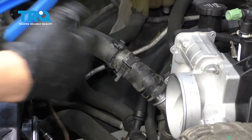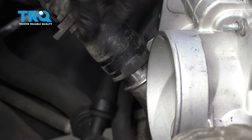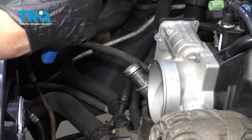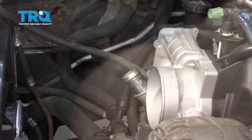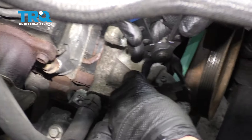If it doesn't come off like that, you can take a pick tool and just slide it in between the hose and the water pump. Loosen it up all the way around. Just make sure the coolant's drained at this point. And take these hoses off as well, the same way — just use your hose clamp tool.